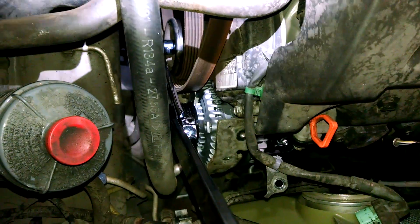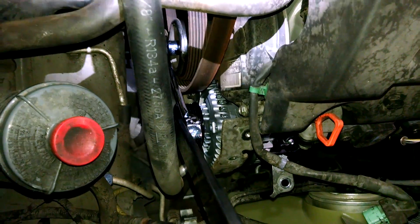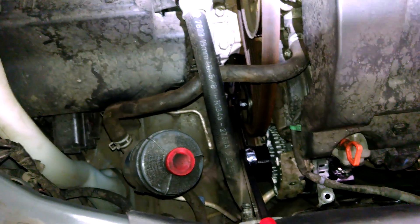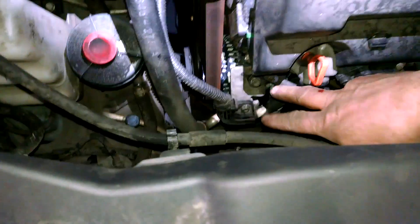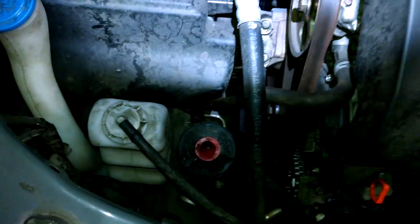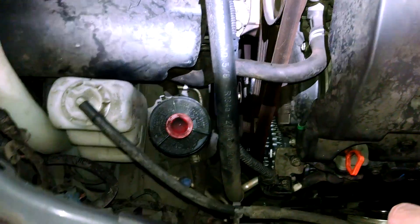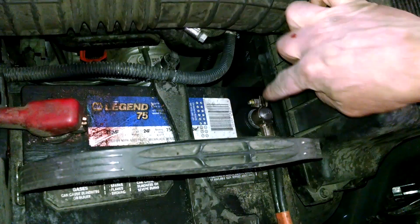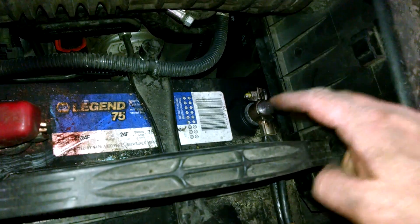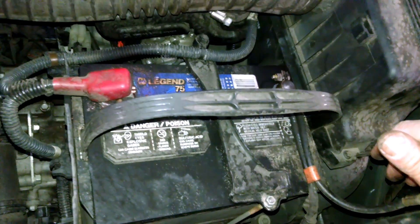We're putting the belt on because the alternator is going in at this point. It's not too bad of a job — a little tight, but with the stuff out of the way you have nice elbow room. Here we are at the beginning or the end: 10mm bolts, power steering reservoir, coolant reservoir back in their slots. For the battery, a 10mm bolt nut — three or four turns and wiggle it loose — tuck it off to the side so it won't make contact and it's safe to work on your alternator.